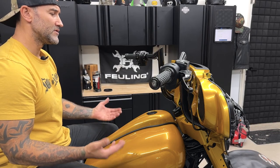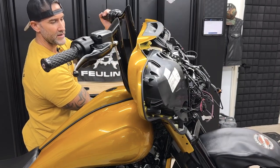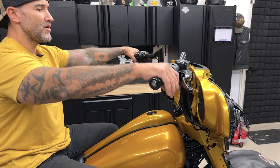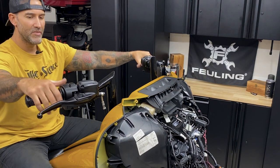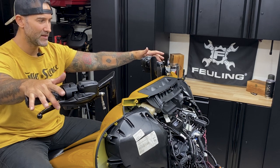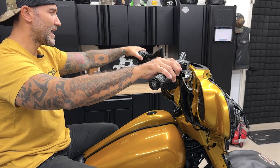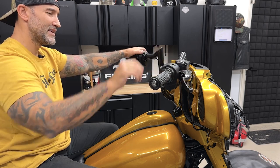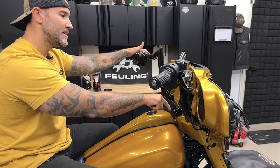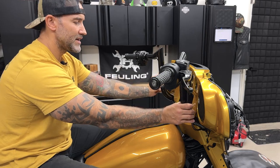Now because I am on a lift, I did use a scissor jack to raise the bike up so I can make sure I had clearance with the bars turning left and turning right, making sure they didn't make contact with the tank. The clearance is good. Now I just want to make sure that my throttle is good — it's not sticking, and my controls are where they need to be. Because I've done this a few times, I kind of already know where to put my switches and my levers. So everything is set, but I will leave them loose just in case something gets pulled. And then I just bring my ratchet up here and tighten them down. So all we need to do now is just tilt this fairing forward so I can access the clamp screws and get those tightened down. And then also zip tie my brake line and my clutch line to the bar. And that pretty much wraps it up. And then I'll throw on the outer fairing.